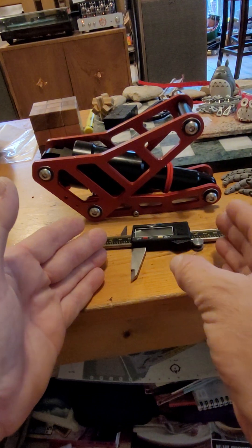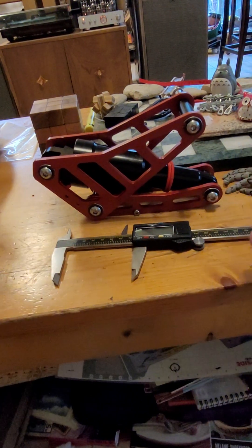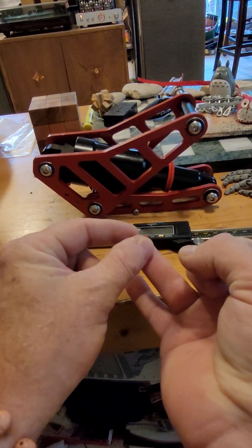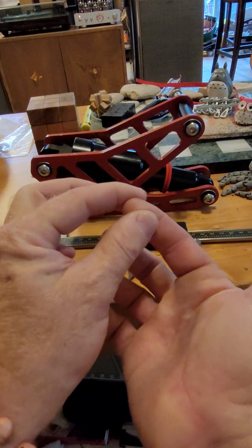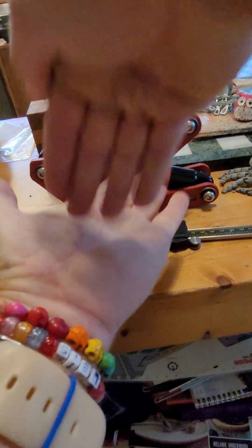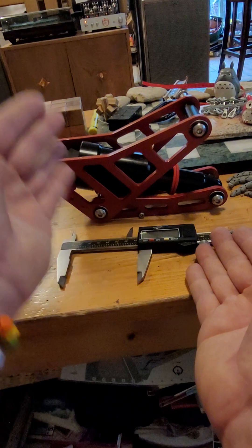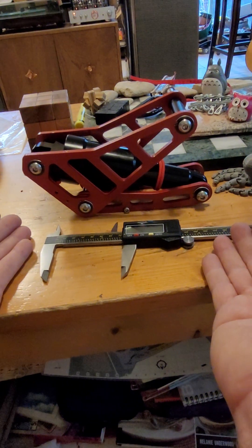When you put a moderately decent mountain bike shock in with 50 millimeters of travel, it's going to completely transform the ride dynamics of the wheel. You'll have correct suspension compression, you'll have dampening, you'll be able to manage the load correctly, and you should be able to ride without bottoming out or topping out. The whole point of good suspension is to keep the wheel sticking to the ground through chatter, jumps, and all the stuff we want to do — and the stock setup is not designed to do that, where a correct suspension geometry will make the wheel have good suspension.